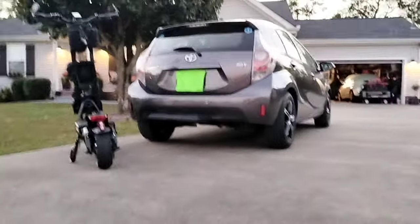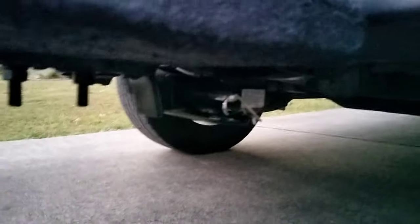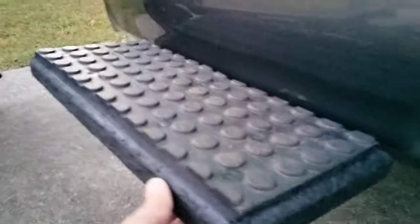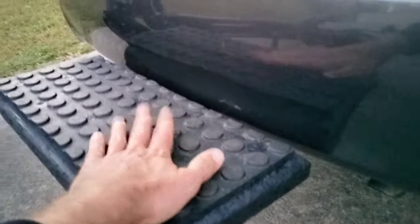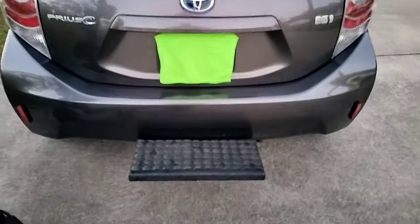On Amazon I got this little black metal bracket that hooks into your trailer hitch — you can see it has some arms on the side and it bolts up underneath that wood right there on the trailer hitch. What I did is put some tar roofing undercoat on here just to give it a good waterproof coating on a heavy duty weather-treated plank, then got some rubber at Tractor Supply — I had scraps so that didn't cost me anything. Screwed it down with some black screws and put a little tar over the top, and this thing literally just slides in and out of your hitch.